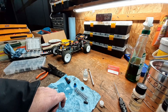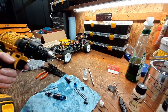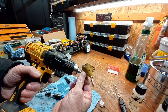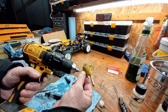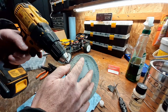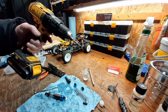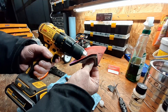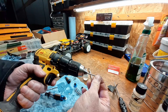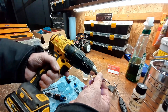I've taken the shock apart and got the shaft down, chucked it in the drill. Starting with the scouring pad - that's smoothed it out quite a bit. Next moving to 3,000 grit, then going to 5,000 grit. I don't know if the camera picks it up but it's very shiny now, really smooth. The back ones weren't bad but I thought, what the heck, I've got everything apart - might as well smooth these out too. That feels a lot better.